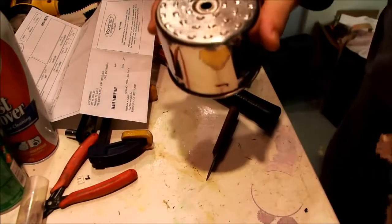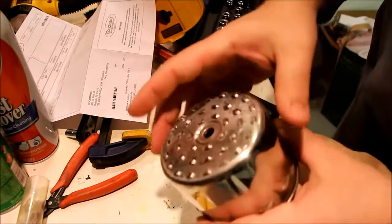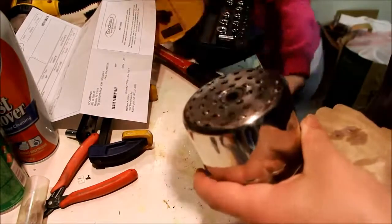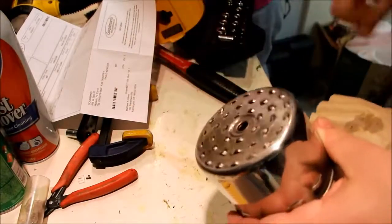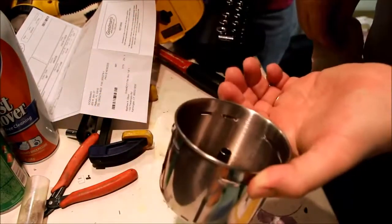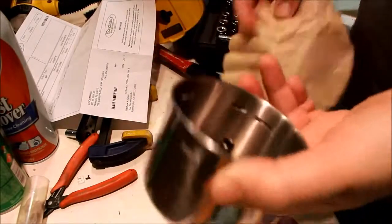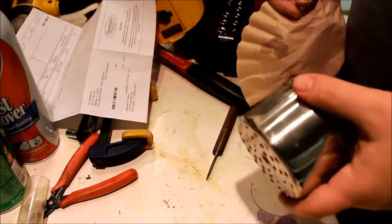Okay, I just wanted to record one other thing really quickly. This is a part to the coffee maker, and this was always getting clogged. So you might be able to see the marks here. I just took a Dremel tool and right here kind of brought the edge back a little bit to open up the hole just a little bit more. I don't typically put coffee grinds directly in here anyway. I use a filter, so it's a whole lot less likely to get clogged. The problem is getting them unclogged is basically impossible because there's no brush that goes in there properly. Anyway, this works pretty well actually for what we're doing. Right, Maggie? Make good coffee?